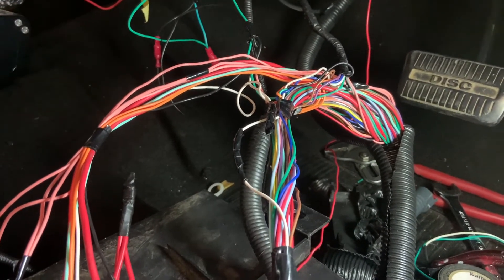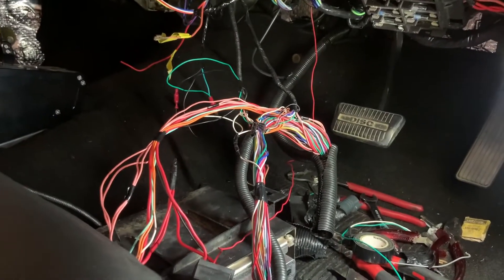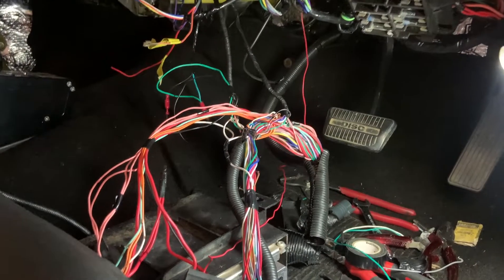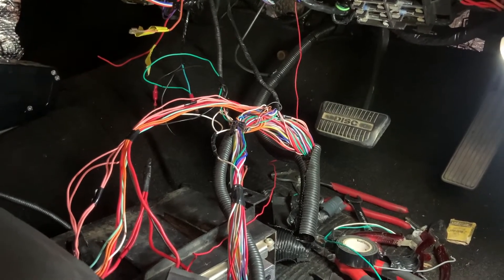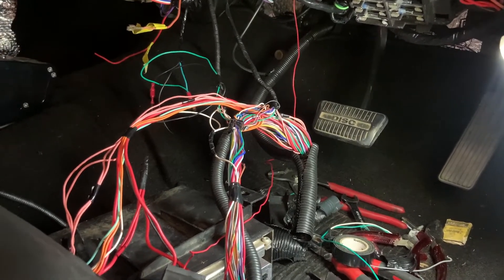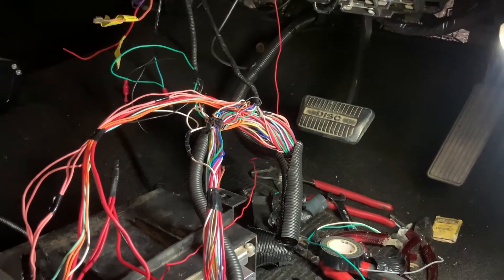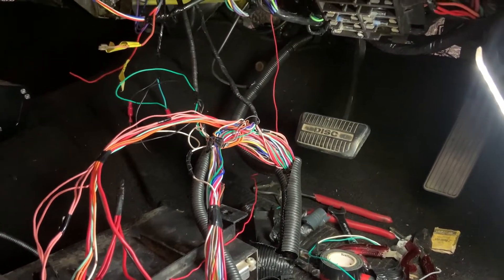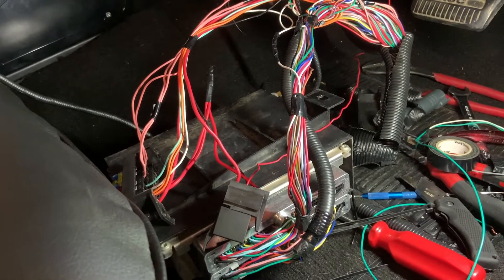So I was always getting battery voltage up there, which was frustrating because half the posts I read said that was possible and normal — but it's not actually a voltage the tacho or dash is looking for. It's a square waveform. Even now that I've discounted that and tried putting resistors in, it's just not working. I'm a little worried I may have damaged my ECU by giving it a constant 12-volt supply at all times.